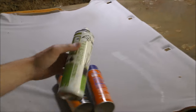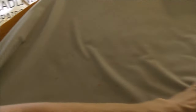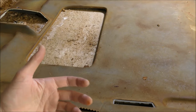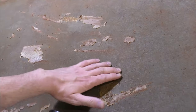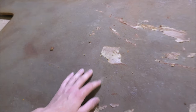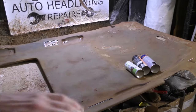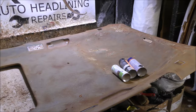We'll show you what happens when you add your own glue to the existing material or use a glue not designed for these cars. This headlining board has been cleaned and prepped for brand new material, but the customer added their own glue. As you can see, all this old glue needs to come off now — it didn't come off with just a single brush. You have to use an orbital sander or a wire brush to try to remove it, because if you keep it on there, you're going to have imperfections that rise through the new material.